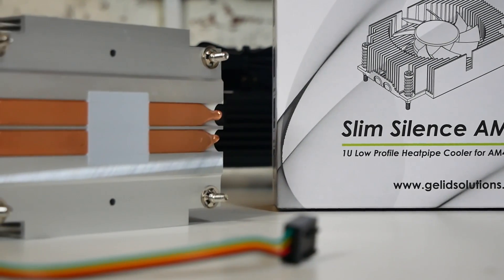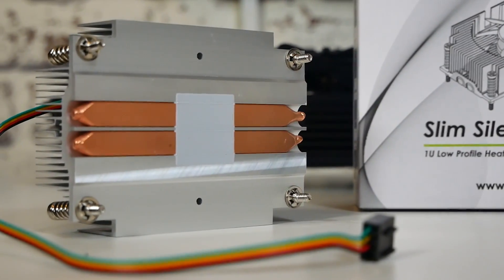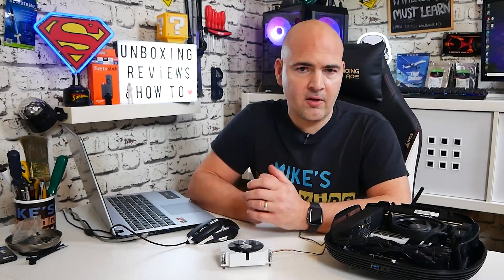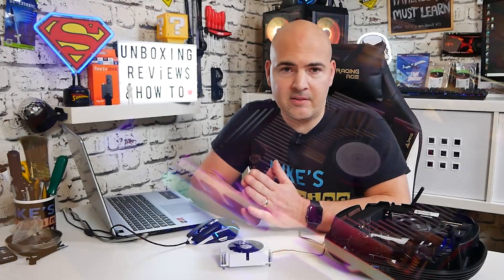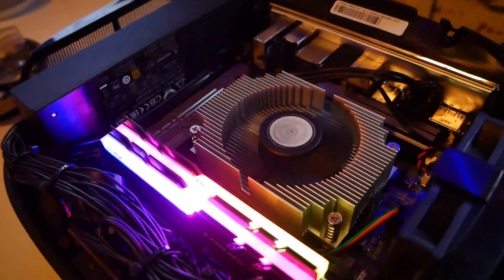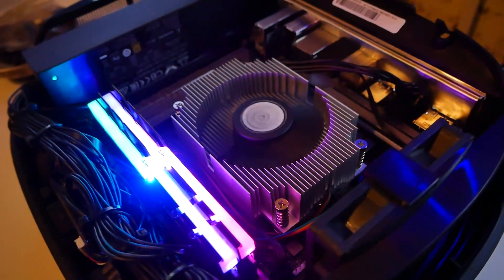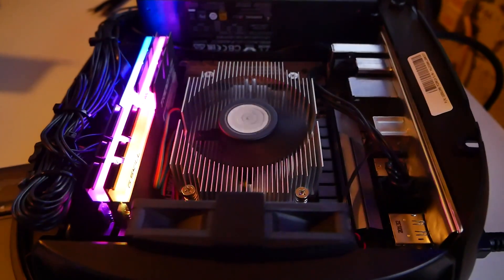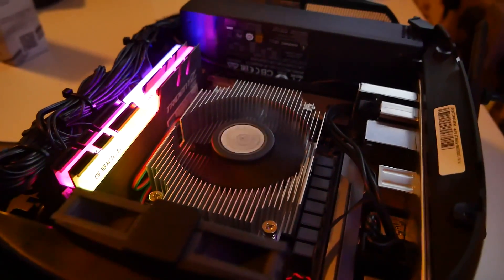To summarize — is it worth actually buying? For me personally, yes. I think for around about £15 to £20, it's actually an excellent purchase and it's certainly an upgrade over the stock Wraith cooler. This is going to come down to personal preference and also your enclosure. If you have an enclosure which is extremely narrow, then realistically on the market at the moment there isn't a lot else you can choose from at this kind of form factor. But if you do have a little bit of extra room, then certainly there are other options available. You do have to take into consideration what processor or APU you're using, because there is only an 85-watt limit for TDP, so you may find that certain processors are going to push that to its very limits. Do temper your expectations and realize that it is essentially a budget cooler and it is exceptionally small. But overall, I think for lower-end processors it's a fantastic choice. Let me know what you think in the comments section below, and if you're building yourself an ITX Media Center PC, let me know what you're putting in it.